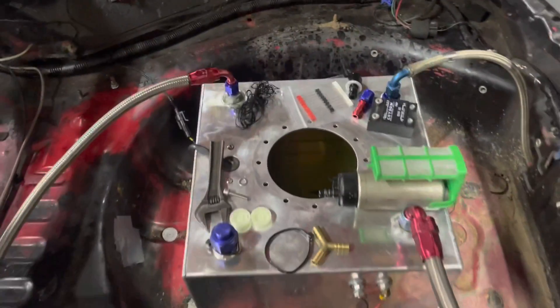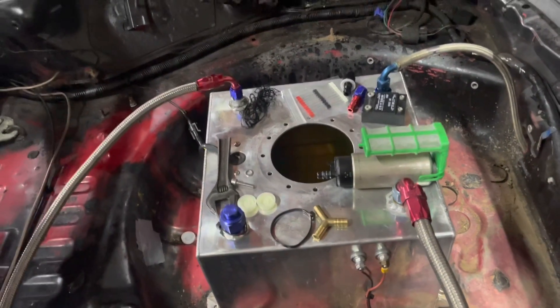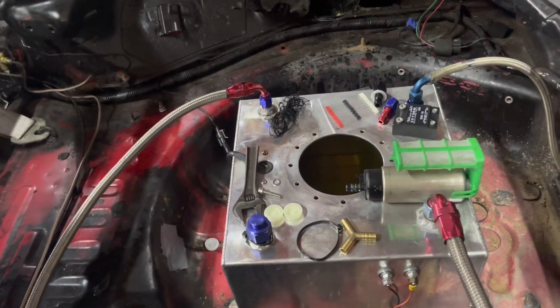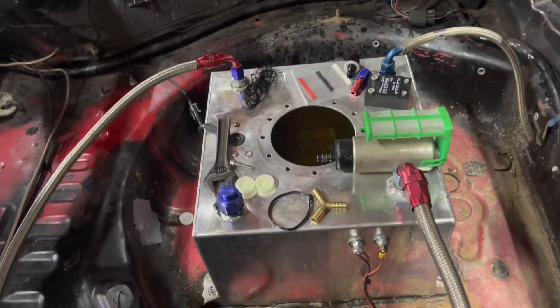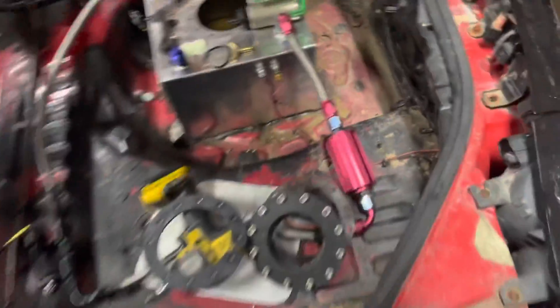You can also see down here, I've got the fuel system apart — there's that big fuel pump I run, the BR540, 540 litres per hour. The pump's an absolute beast, I love it. But I've bought another 525 Hellcat pump, because I'm going to run them both at the same time. There's a Y-piece there that I'll use. It's dash 8 outlet on this stuff, so it's all pretty big. And the solid state relay down there — I'll use pulse width modulation so the pumps aren't running full bore all the time. I'll have them at quite a low duty just to get the fuel pressure up, and then as boost goes up, the PWM will go up as well, and the pump speed will increase.